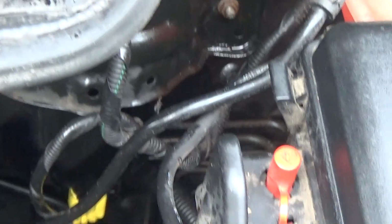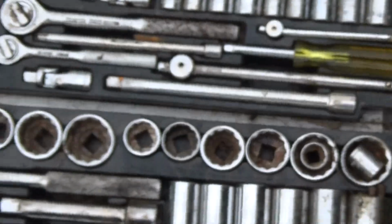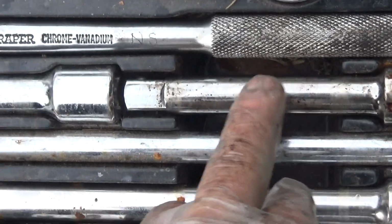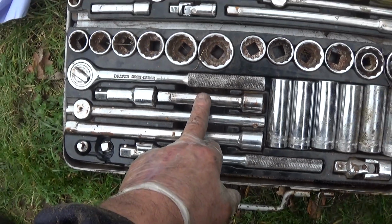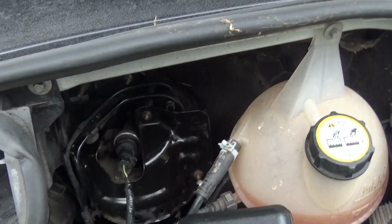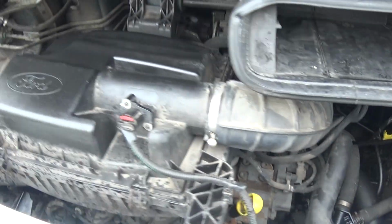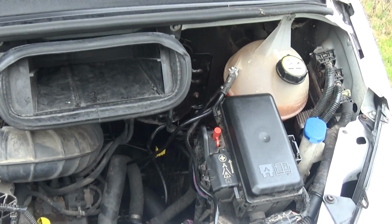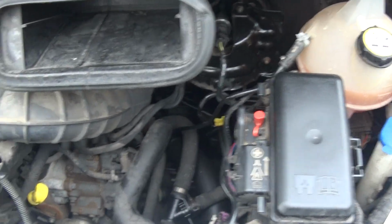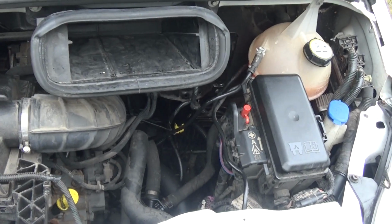Then when you're trying to pull it round, I used my small extension bar and the breaker bar. You're thinking, oh, this is going to break, because it's flexing. But just be firm with it, and it'll go. And you'll know when it's time for it to fall out. It just moves a couple inches to the left, and then it drops down.